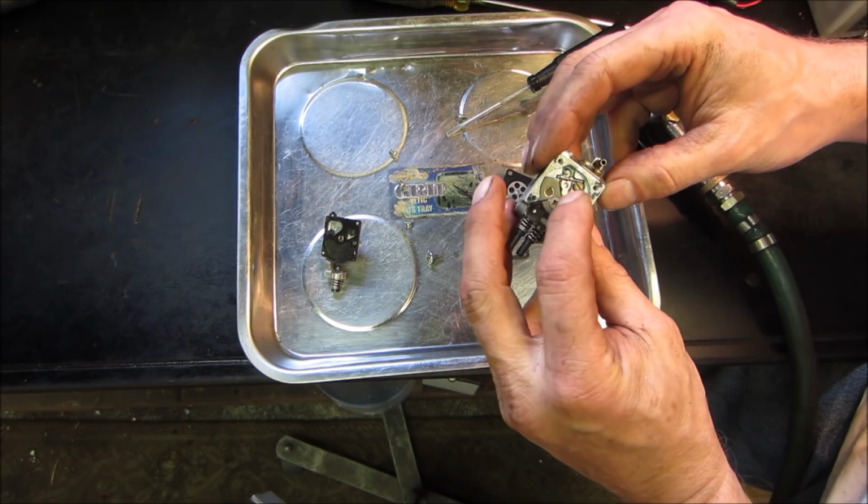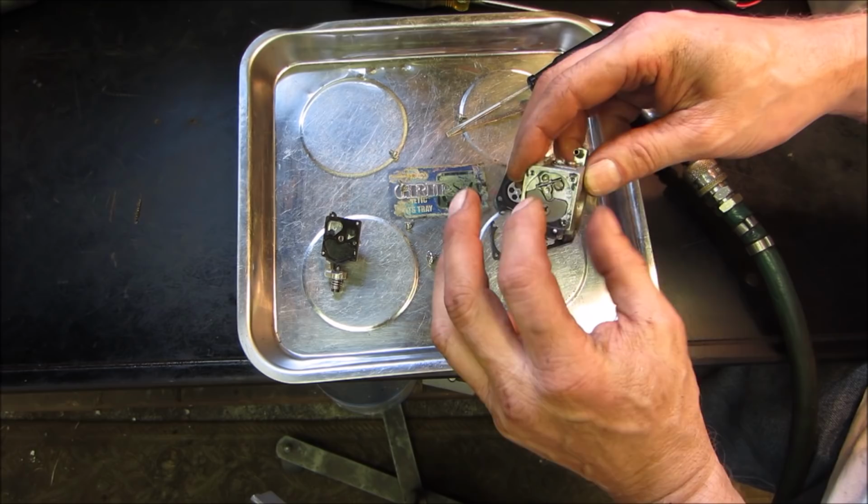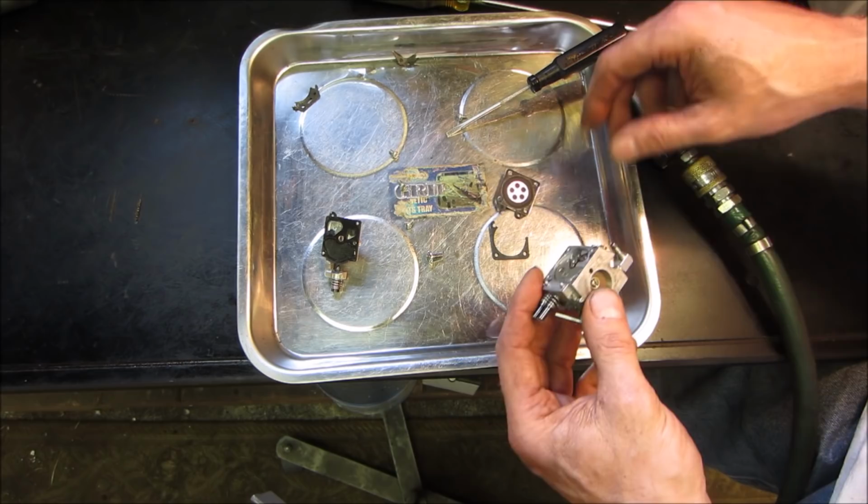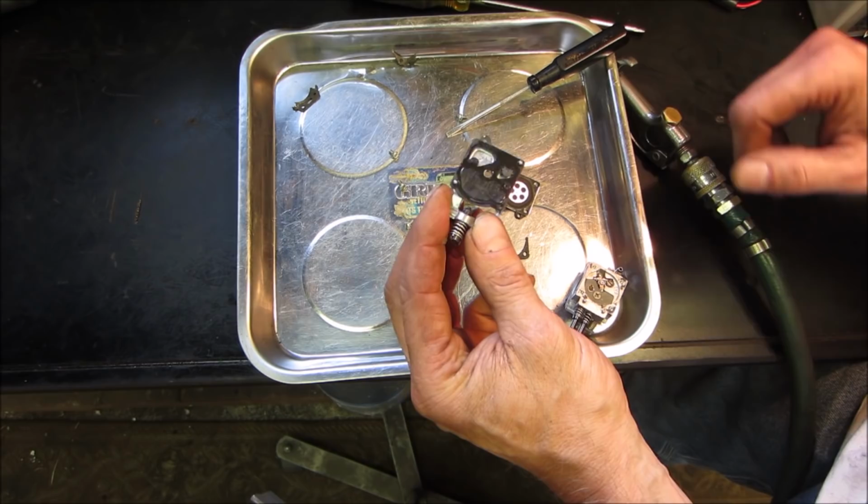It seems fine. It was really clean. Johnny, just take that screw up. It's a bitch to get that little spring back in there. The gasket is gone. Hopefully I have something laying around that we can replace that with. But I think, again, most of it, the reason why I wasn't pumping any fuel is because of that one right there. I would call that our suspect.